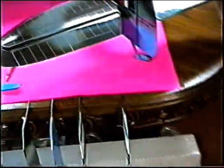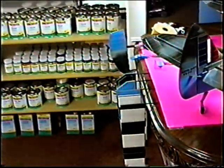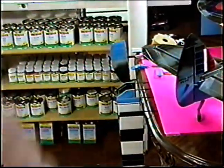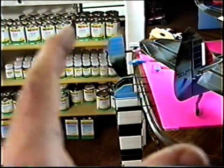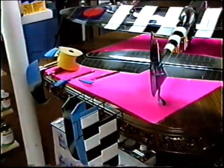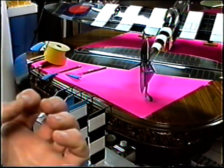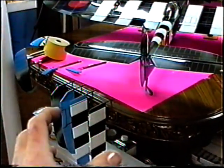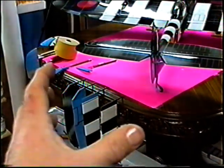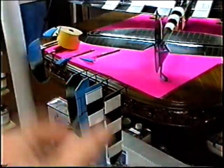This is the hard part now. What I'm going to try to do is get one coat on every day, maybe for a week — five, six, seven coats. If you put one coat on and another coat in a half hour, yeah, it'll dry out, but you run the risk of it drying soft, trapping thinner in there, and adding unnecessary weight. In the lifetime of this plane — which we hope is going to be long — this week won't really matter. Each time I put another coat on, I'll add a little more thinner to the mix. I'm going to try to put on a little less than two quarts of clear total, which for the sanding and buffing should be plenty.